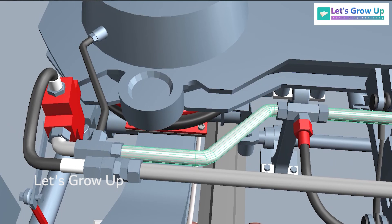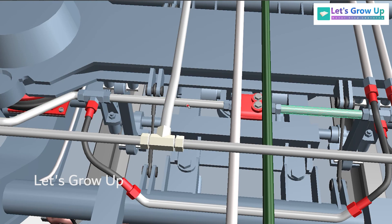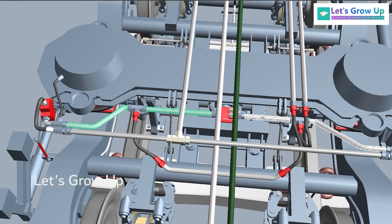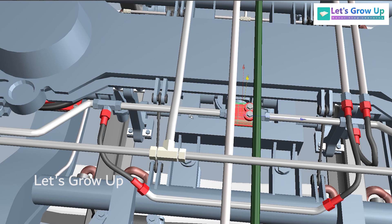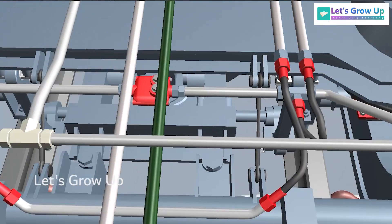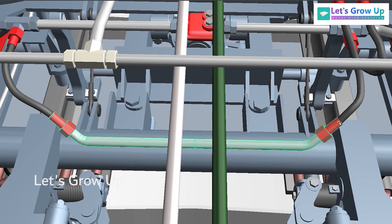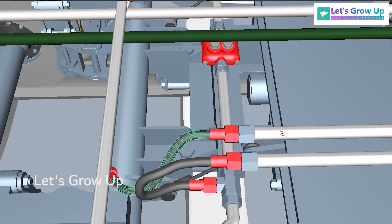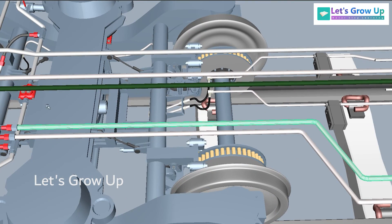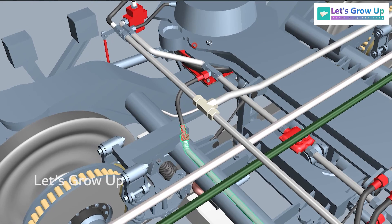The pipe continues — leveling valve output pipe continues through the duplex check valve. Think of this as a single pipe with the duplex check valve in the middle, and this pipe is jointed with the leveling valve. In between, you can see the flexible pipe connecting to FIBA. This pipe is going to FIBA and this pipe is going to FIBA — one for each side air spring with the duplex check valve in between.